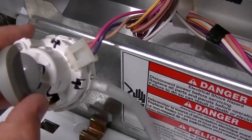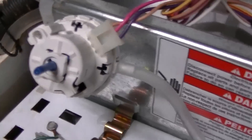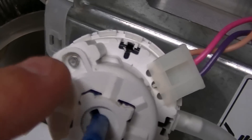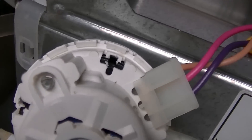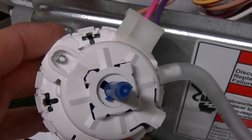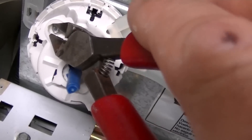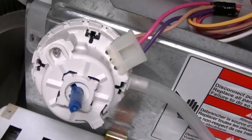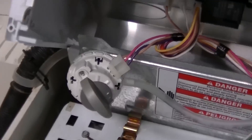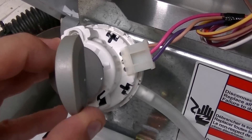It means it's full of water. You can take this knob off right here — see this little screw right here? We're going to put about a quarter turn on that and make an adjustment. Sometimes it has a little bit of glue on it; just break the glue off. The screw is very small, so some cutters will help you. I recommend quarter-turn adjustments so you don't have to start the whole refill process over again.